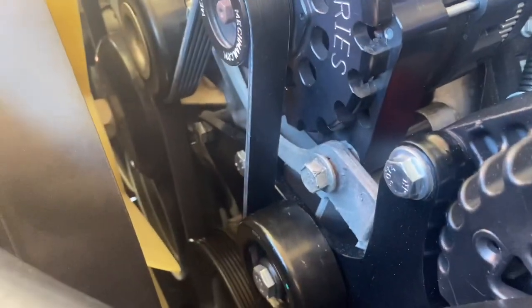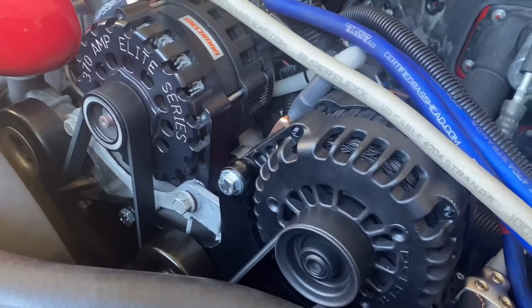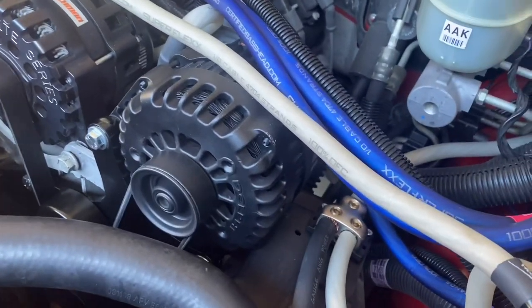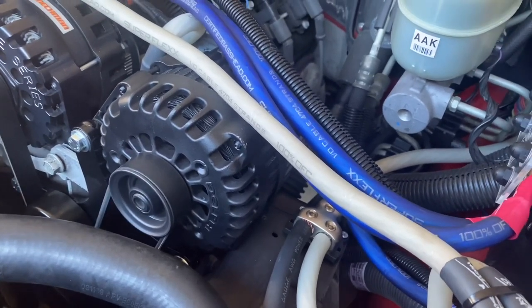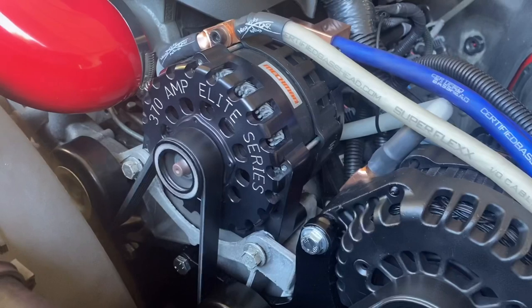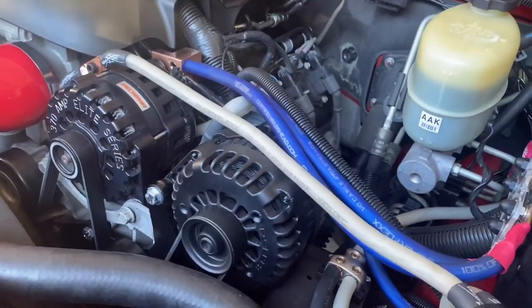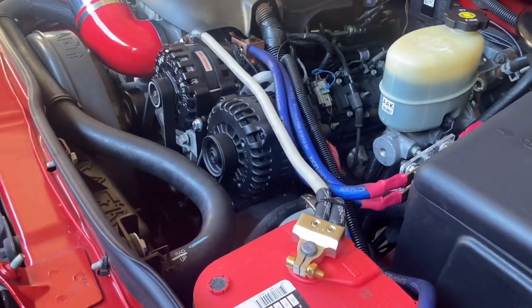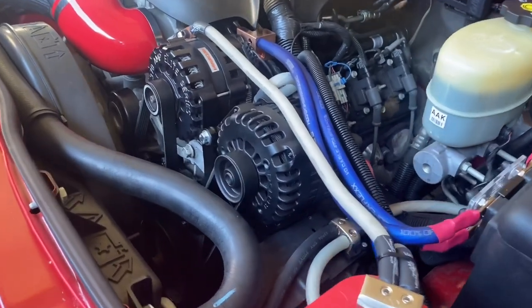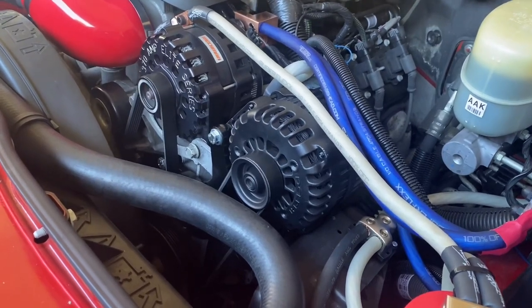After a little bit of pain, anguish, and grief, I got the belt routed. Putting the intake back on and firing it up — and there it is, set up and running properly. The stock alternator is charging my truck's electrical system at about 14.5 volts, and my Mechman Elite 370 is charging up my lithium at about 14.8 volts. Two complete electrical systems running in harmony — exactly the result I was looking for. If this was of value to you, please subscribe, like my channel, and turn on notifications. Let's get loud!